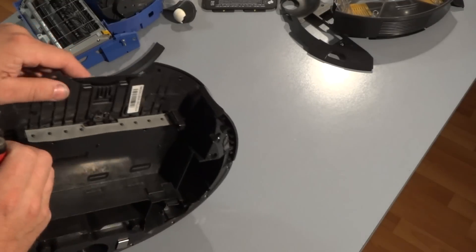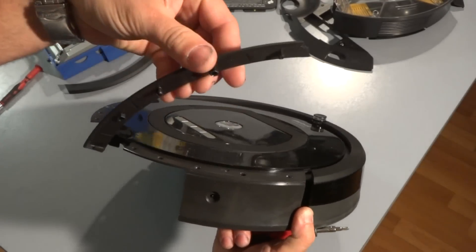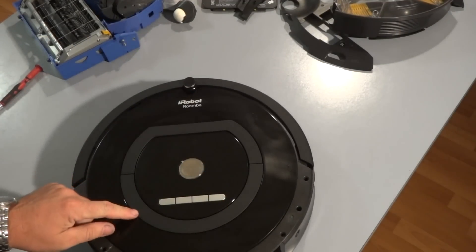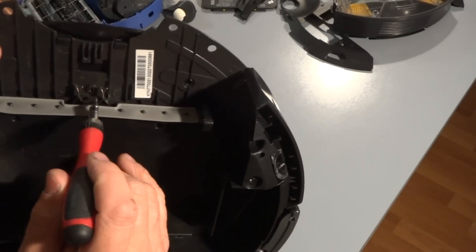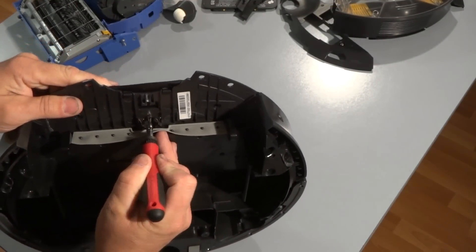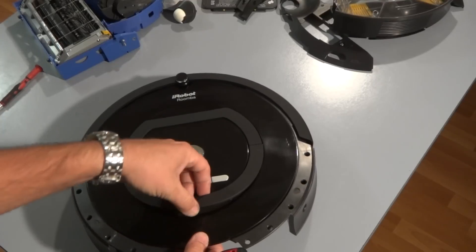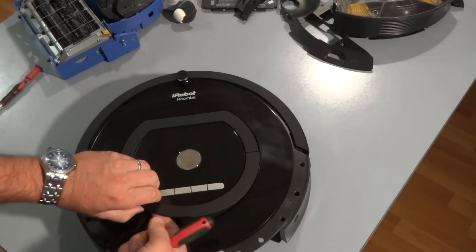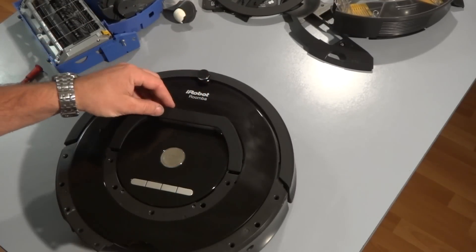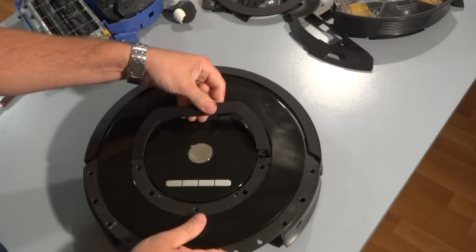With your thumbs just go ahead and pick the piece out — really easy. Push the hole out on the other side, pull back, and that piece comes off too. Then you want to remove this piece of plastic before you do the handle, because it holds the handle. Right between the connectors for the vacuum bin, you'll see a hole there — just use a screwdriver to push on it, maybe sideways a little bit. When you push on it, this plastic just pops up right here. Grab it with your fingers and gently pull it up. Now you can remove the handle by pressing down and pushing it towards that way.